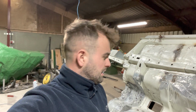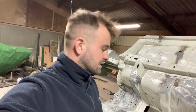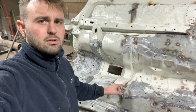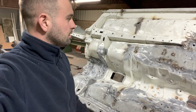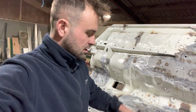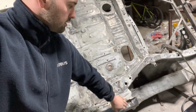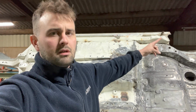What I did instead was, I've been and welded, there's loads of tears and stuff, you know, holes and bits and bobs. So I've been and, you can see where all the discoloured bits are basically. I'll sand them tomorrow with a flapper wheel. But I've just gone over and filled a few of the areas. Filled that hole in the sill down there, this bit, from when I cut them brackets off.